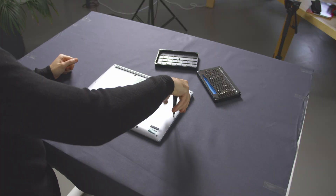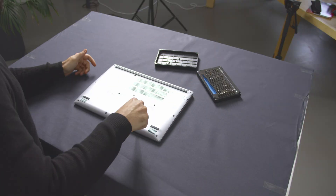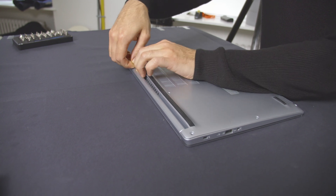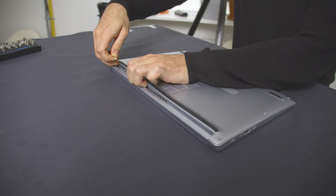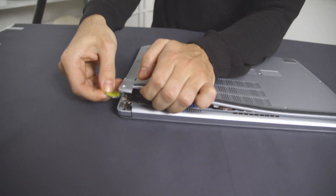After completing these necessary chores, let's get to the fun part and loosen the 11 screws that hold the back cover of the laptop in place. Once you've loosened the screws, pry the back cover open with a spudger, guitar pick, or the aforementioned fingernails. The best point of entry for our model was right here at the hinge mechanism of the Aspire.